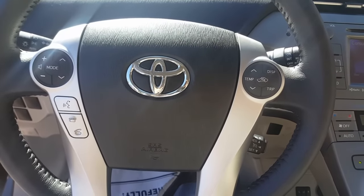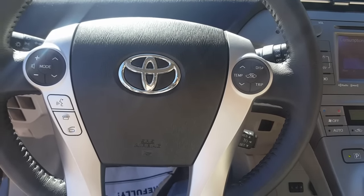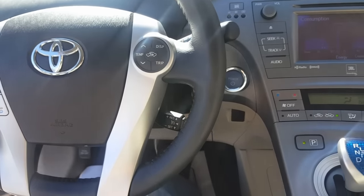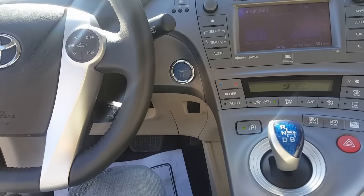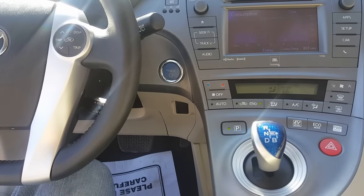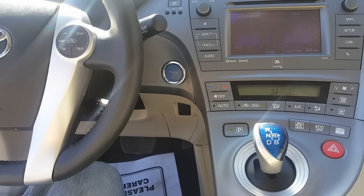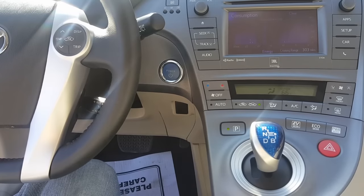This procedure will work only if you perform a wheel alignment and the lights come on, or if you replace the wheel bearing and the lights are not going away. These are the steps to take if you don't have a scan tool. However, if you have an actual fault in a wheel bearing, or if the wire from the ABS speed sensor to the harness has failed — which happens a lot on these Toyota Priuses and Lexuses — that will not reset with this method.